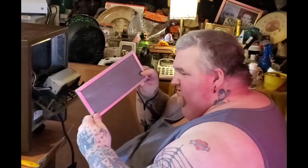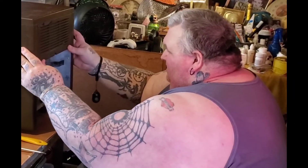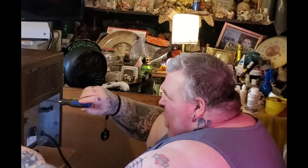I'm going to stop the footage for now and get this cleaned up, then I'll show putting it back together — basically doing what we just did in reverse. Okay, I'm back. This little remote is just what I use to start and stop my video — it came with my little tripod I bought off Amazon. Look at the nice job my wife did cleaning the filter — beautiful job. We just slide our filter back in where it came out, make sure we put the top part up underneath the lip first, click that into place, replace our screw and tighten it up — tight until you see sparks. And there you go — one cleaned heater. Nothing to it.